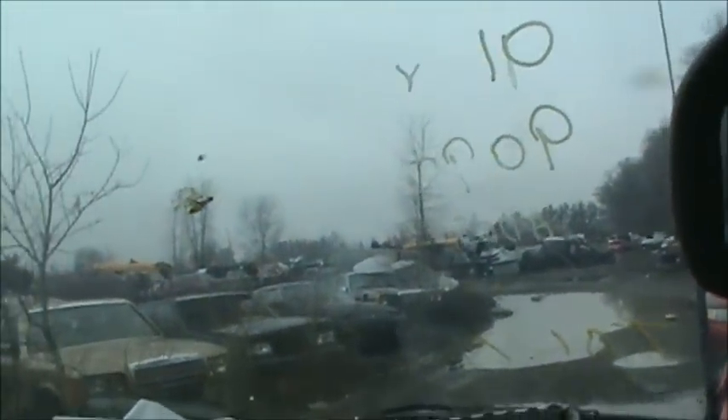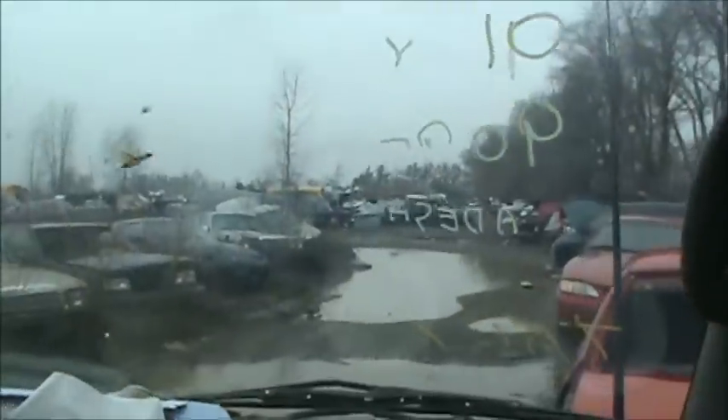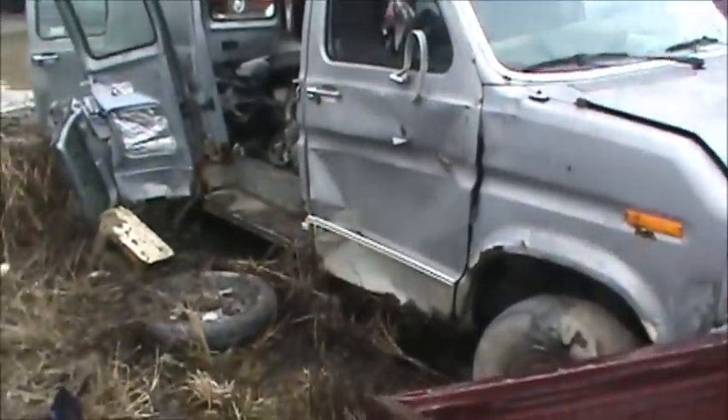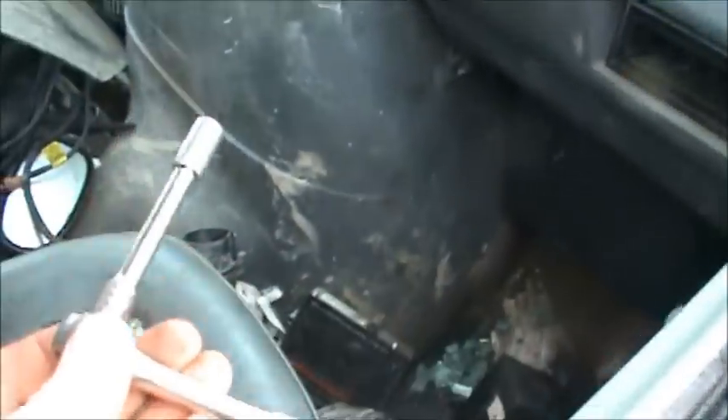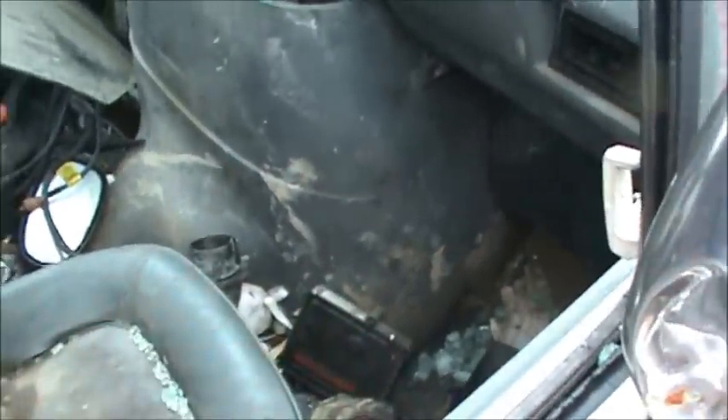I brought the wrong footwear for today but going to get a little wet — not a problem. The guys up front are waiting for this window. These old vans usually have a big motor in them, so the first thing I do is try to open up the door — of course it's busted. Anyway, you take an 8mm with an extension and stick it right in the middle underneath there and undo that, then come around to the firewall and undo that side, then come back and pull it out.